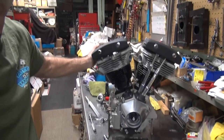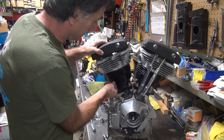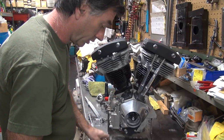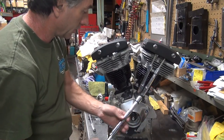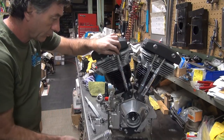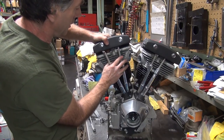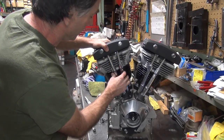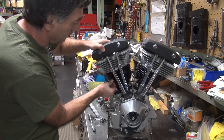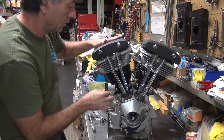I'm going to rotate the motor over — they're gonna go up and down a little bit. This one's opening up right now, this piston's starting to come up. We're at top dead center right now, so I can put this one all together on this side. This head goes up like that. We got to get these two valves in here.